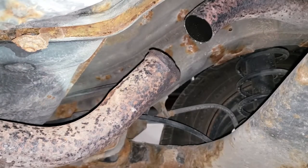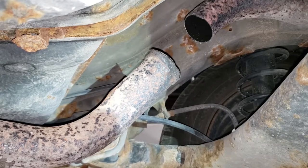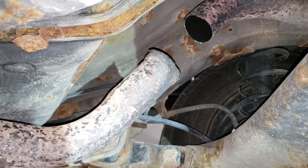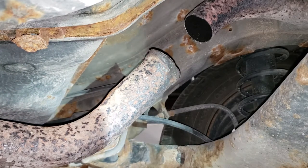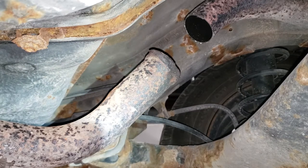Well, here's a tip, boys and girls. If you get a death wheel or cutoff disc, it makes your life a lot easier with the Sawzall, because the Sawzall has a path already carved out of the pipe so that it can fall right into it and cut the pipe much easier. I'll show you how to do that now.